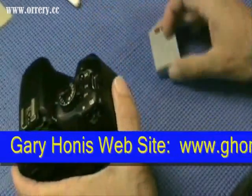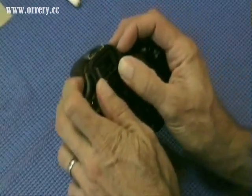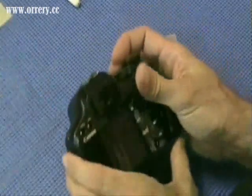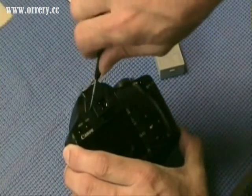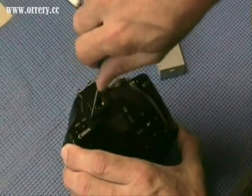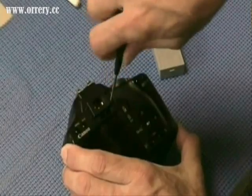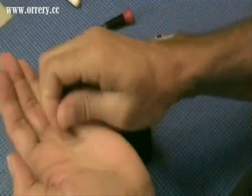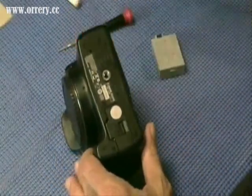This is how you can modify a Canon 450D or 1000D using the instructions on my website. With the camera's battery and SD card removed, we slide up the viewfinder cover, which reveals three screws below it. We remove those three screws. On my website you can print out a sheet that lists the step numbers, and the purpose of the sheet is to tape these small screws to the corresponding step number. The screw sizes are also listed there.